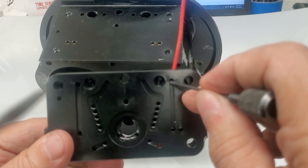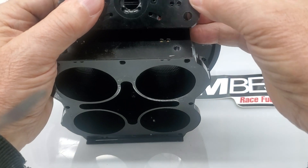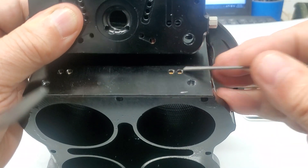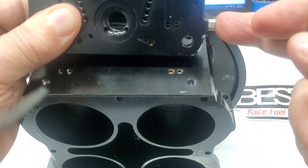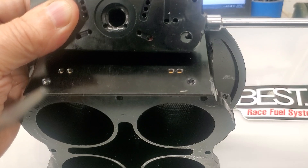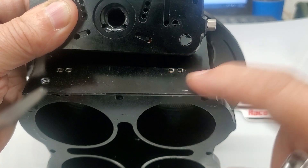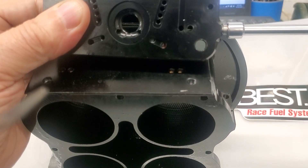So that's where it goes — up here it'll catch the air bleed from the main housing. Through the gasket, it comes down this position here and feeds the transfer slot — two positions, one next to the other. Getting in a little closer, you can see the transfer slot adjustment is directly above this one, and the idle adjustment is directly above that one. You have an idle jet, but you also have what they call a curb idle, which is a needle-and-seat going through the side of the main block. You can completely shut off any fuel going to the idle by just screwing in the curb idle — it is a needle-and-seat adjustment you can access from outside the carburetor without taking it apart and changing the jet in the main housing. Here you can see the screw going in and out.